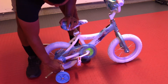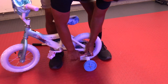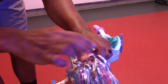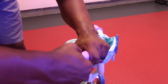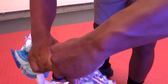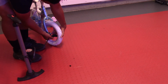As I mentioned earlier, the rear brackets for the training wheels allow adjustment up and down depending on the experience of the rider. I've gotten them to where I want them — all the way down — so now I'm going to tighten these up. Almost to the finish line with this bike install, I'm going to put in the streamers. The handlebars on the side have little holes and you just pop those right in. Secure it tight. Same deal for the other side — just push it right in there and wiggle it around a little bit until it's nice and flush with the handlebars. Now you can put some air in the tires, front and back.